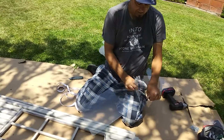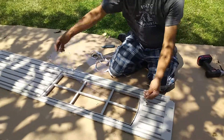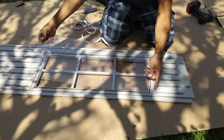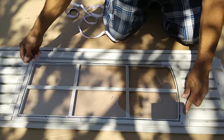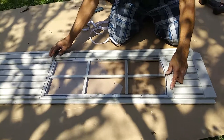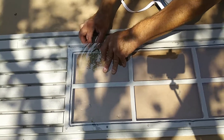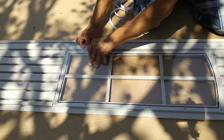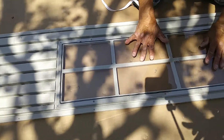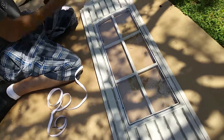Then you lay in your window. You peel both sides just like you see here — they're ready to go. Peel both sides, inside and outside. These window holes — you've got to make sure they line up the right way. See there? That was upside down. I flipped it real quick to make sure that the holes line up before you drop it onto that little sticky stuff. When you see all the holes all the way around are lining up the way they're supposed to, then you know you've got it right and you can slowly lower it down perfectly so that each hole, going all the way around — there are like 16 or so holes — each one is lined up nice with the little pre-drill hole spot where it goes, all the way around the window pane.